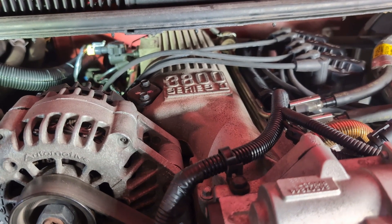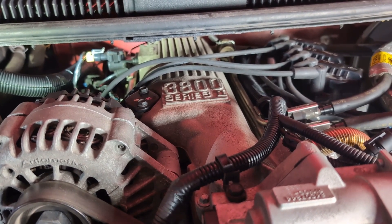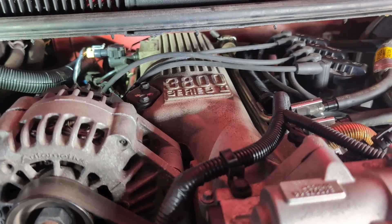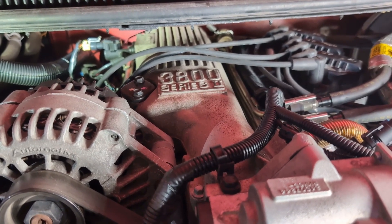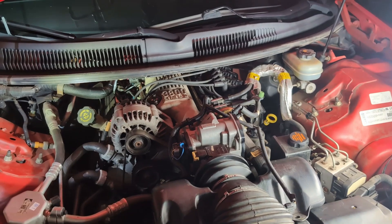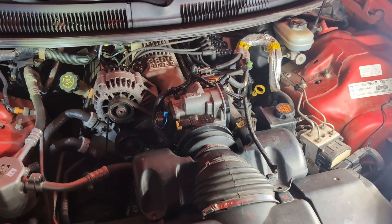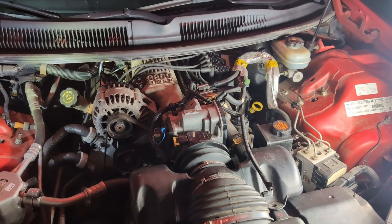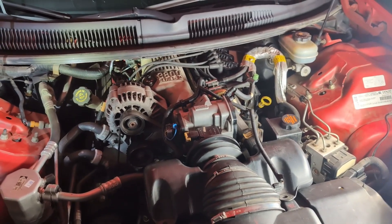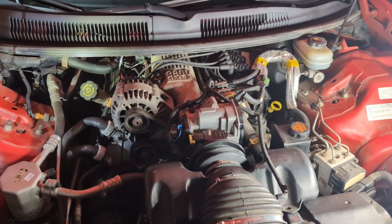The engine is rich and can't trim anything back — it's trying as hard as it can, but fuel is coming in straight through the intake where fuel should never be, getting into the cylinders and causing a rich condition. That kicks off all the other codes because the rich condition affects a lot of different things — the O2 sensor sees that the exhaust mixture is wrong, too much fuel in the exhaust. You can smell it everywhere. This car would not hardly idle; when you ran it hard the engine speed was high enough to burn the fuel, but at idle it was very hard to keep running.